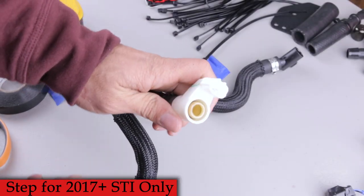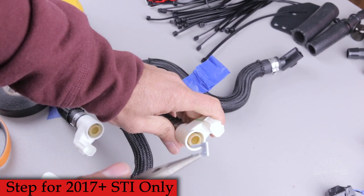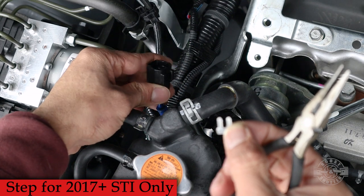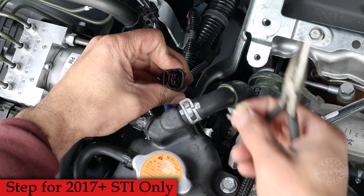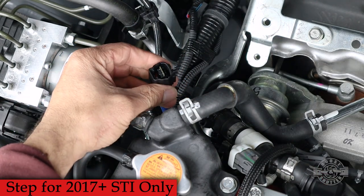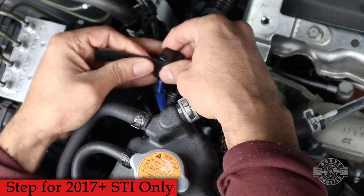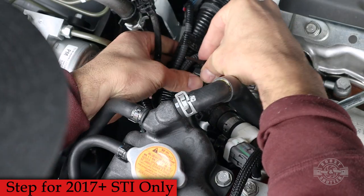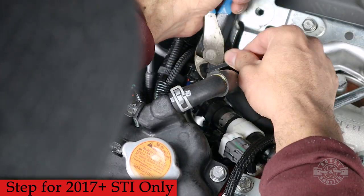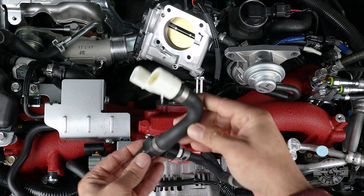Back at the table, grab those hard breather lines and use needle nose pliers to pull the jumper out of the passenger side ventilation sensor. Grab that jumper and the sensor's electrical connector that we unplugged earlier, and insert the jumper just like we did before. Make sure the jumper is actually where it should be and be very careful not to drop it. Protect the dummy connector with electrical tape, then grab a zip tie and secure it to the cable harness.